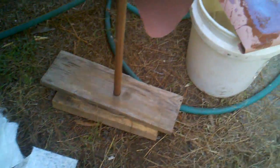So I take my mat and cut it in about 5x8 pieces, and then I'll lay it over here, and I'll lay one piece of mat down. Well, first I resin this, then I lay one piece of mat on, fiberglass it, and put the other one, overlap it, all the way down, and then put them all on real quickly.